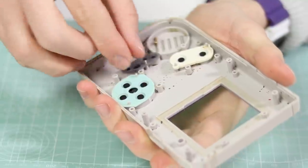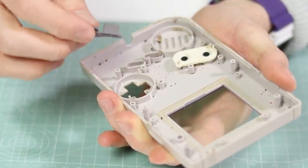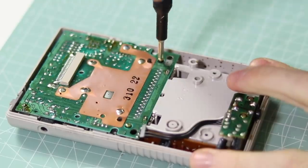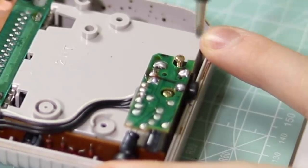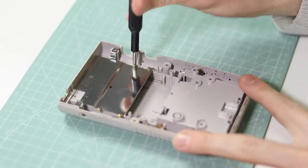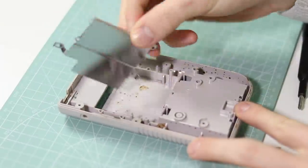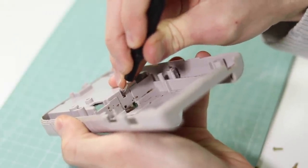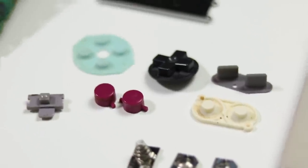As we lift out the motherboard, you can see how disgusting it is inside. Being that this was built for customers to walk into a store and play on, there's no wonder there are so many stains and spills on it. The button wells are grotty and very worn, which is actually a good sign of this thing's legitimacy. It would have been in situ, mounted in the kiosk, away from pockets and knocks and drops, so the outside shell is immaculate. With all of the parts laid out, let's focus on cleaning the buttons first, then individually clean the shell halves, being sure to keep the stickers dry.